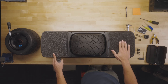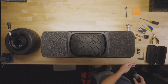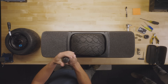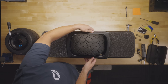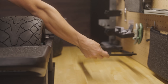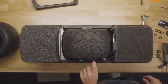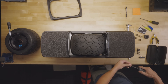Go ahead and place the Onewheel face up with the handle towards you, then grab your TP-25 and remove your fender. Careful not to lose your screws. Another thing that makes this a lot easier is removing the mag handle — use this long three millimeter bit.